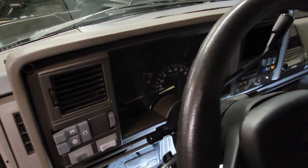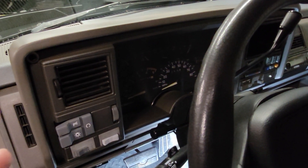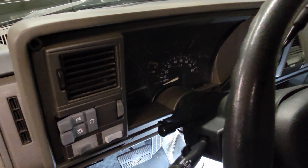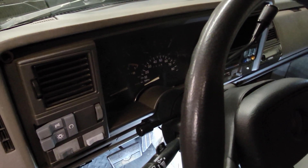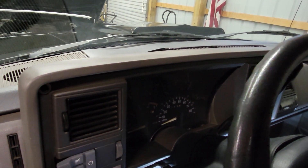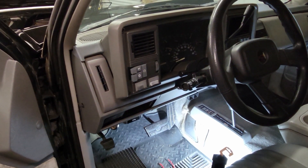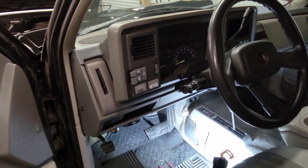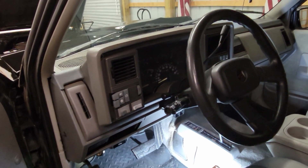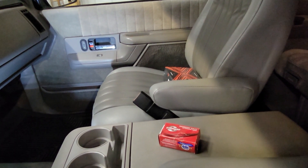This is a new-to-me Blazer. I had driven it home — multiple hours, two to three hours — drove it home, had no issues. Got home, had a check engine light come on really quickly, but it was related to the battery. Fixed the battery problem because they had an adapter on an adapter on a ground cut-off, just a stupid mess. I removed all that, got new ground cables, and that fixed it. But then after I filmed the walkaround video on this bad boy, wouldn't you know it — the light came on again. My issue was I could idle, but if I pushed the gas it just powered down and would struggle to run. It wanted to shut off, and then would kick back on. So I idled all the way home, which was a real treat.